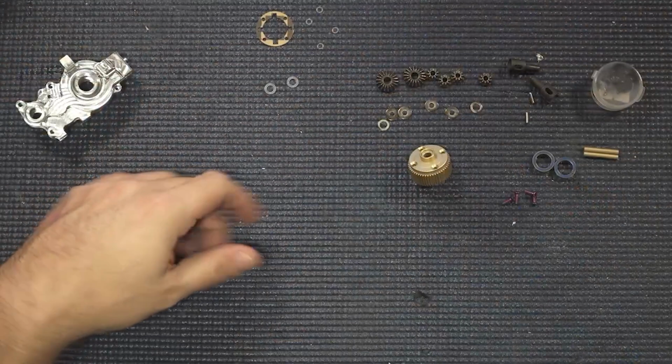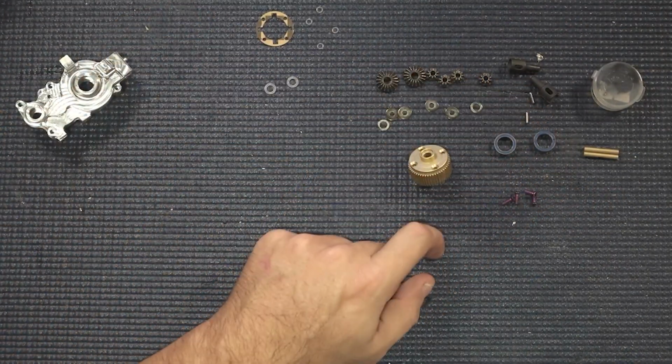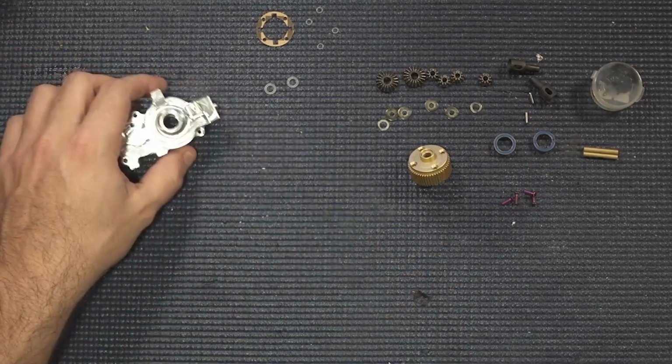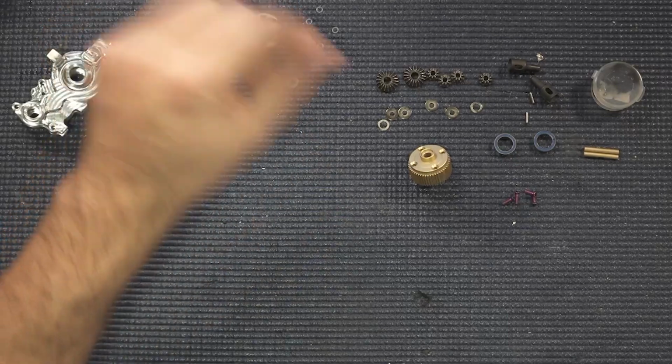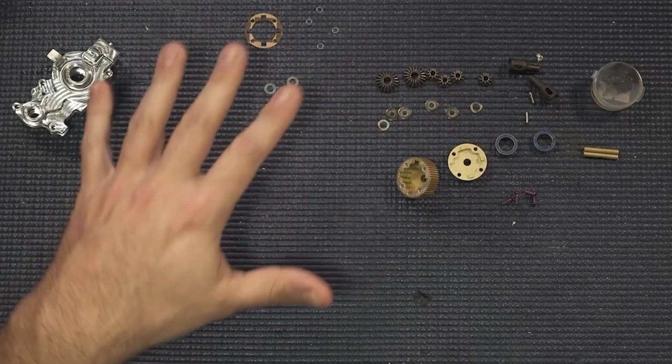One thing is, especially when you get into doing your gear diff servicing, is you never want to short yourself. So you always want to change out things like your bearings, for example, that are here. You want to make sure that they're always nice and clean. You want to make sure that things are shimmed up properly, which we will be doing. O-rings, all the different things like that. Your seal, planetaries and stuff. Possibly you could get away with reusing some of this stuff that you'll have in a kit, but you're going to have to clean them up and do all that kind of stuff.